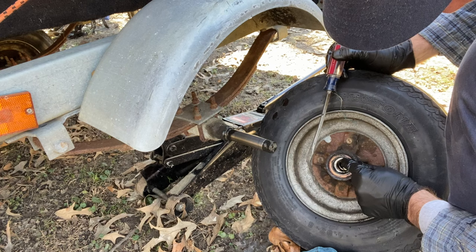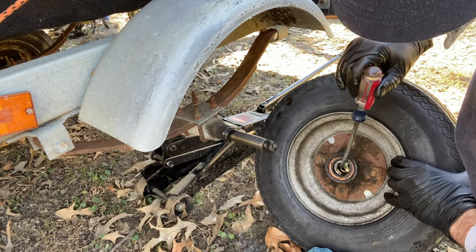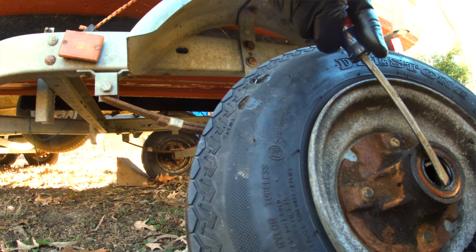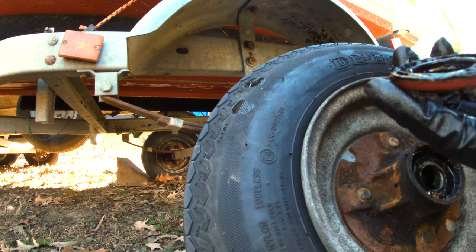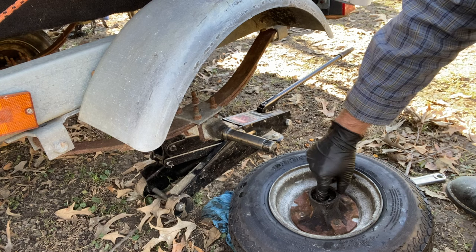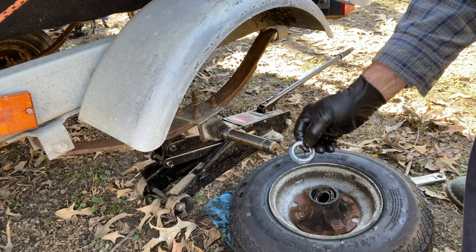There is the flat washer — somebody placed it on the inside of the rim instead of the outside, which is very odd. I think somebody put this one together wrong the last time. I'm putting my screwdriver between the seal and the inner bearing and just popping on it with my hand — and it popped right out. You can see how that seal fits and goes all the way up into that wider part of the axle shaft. And here we have the inner wheel bearing. On this type of rim, the inner and the outer wheel bearings are exactly the same, so they're interchangeable.